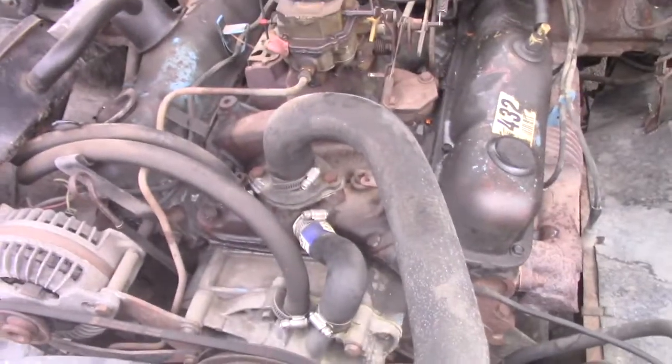When I put the plugs in I totally spaced gapping them. The gap is supposed to be .035, so I thought I'd pull the plugs — maybe they're gapped wide, maybe narrow, and maybe that'll help. I also checked the oil: earlier it was a little over full, and this morning it's about halfway between the lines, so she uses a fair bit of oil. The buyer's remorse is strong with this one.